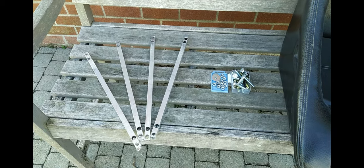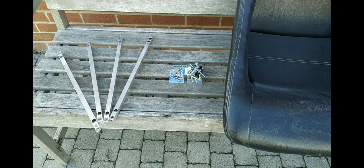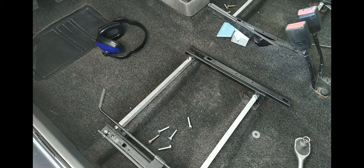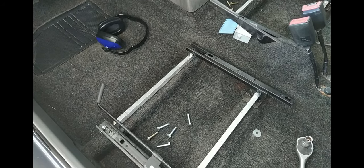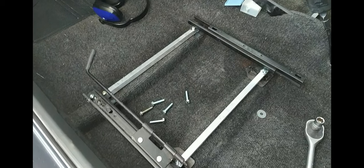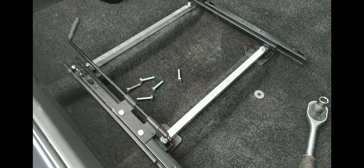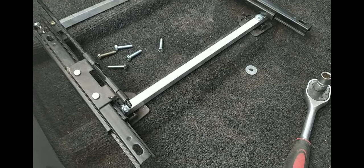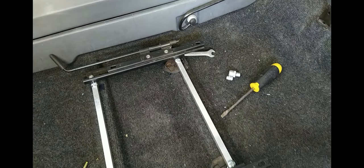The plan was pretty simple. Using a 2mm aluminum strip I could simply attach one rail to the holes in the car, and then attach the other rail to the holes fitted in the seats. To be honest, quite genius if I may say it myself. The seats were installed directly after I fitted these rails — unfortunately I don't have any footage of this. It's actually really simple: the four bolts go through the rail into the seats using a washer just to make sure.